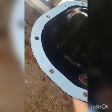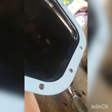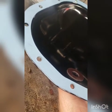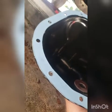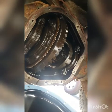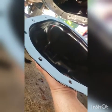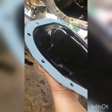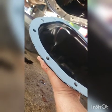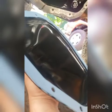I got the seal on. I did a very, very light coating of RTV. Because if you have a gasket, you really don't have to use RTV - some guys say you shouldn't because you don't want to double it up. But I did such a thin coating and it's really just to hold that gasket in place. In my opinion it's going to help. You don't want to over-RTV it. We're going to stick it up there, do a bolt on the top, bolt on the bottom, and then go through and turn them all in by hand. The nice part about using a light coat of RTV is if you're only making a gasket out of RTV, you don't want to crank it down until after you've given it an hour or two for the RTV to cure, tack up, and create somewhat of a seal. With this gasket, I can give it maybe an hour or two and then I'll be able to add the fluid.